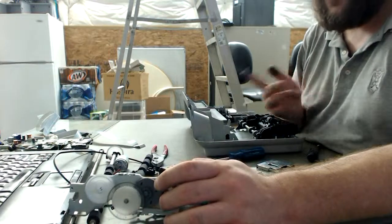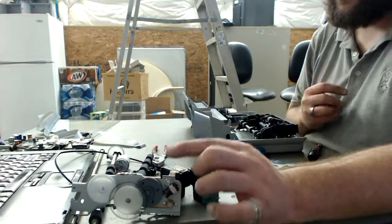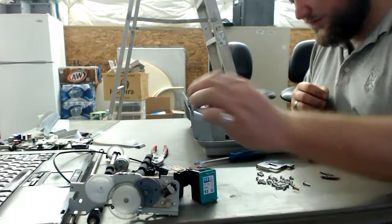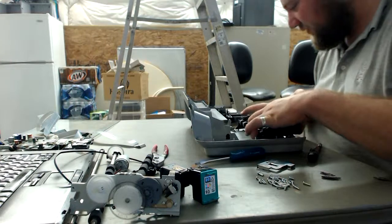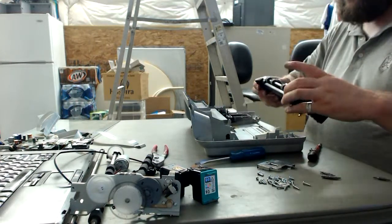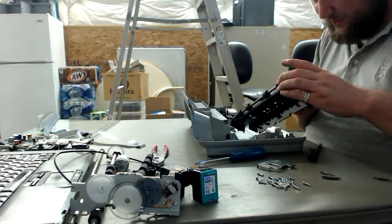Ideally, if you hook it up to an interrupt on the Arduino and make it so it's binary logic, you can watch a DC motor spin as it goes and then stop it almost instantaneously. Obviously, you want to profile it to see how fast it goes after you cut power to it. And there's another spring that just flew away.